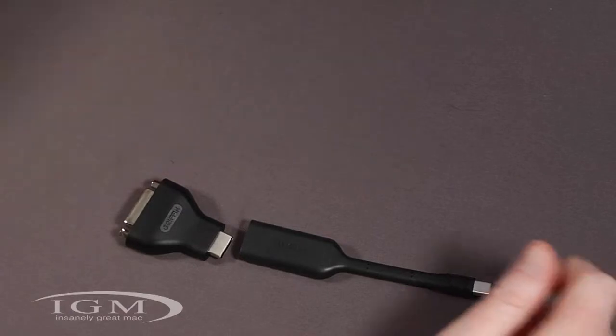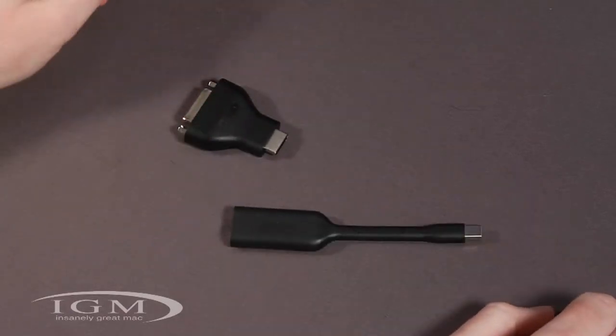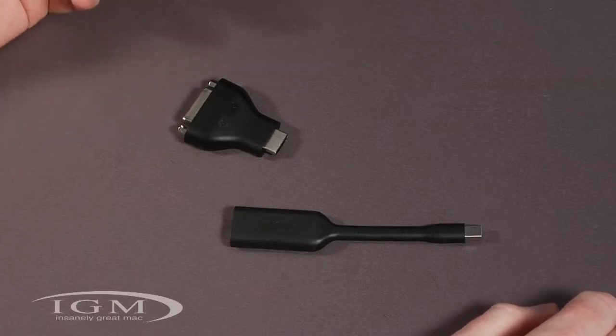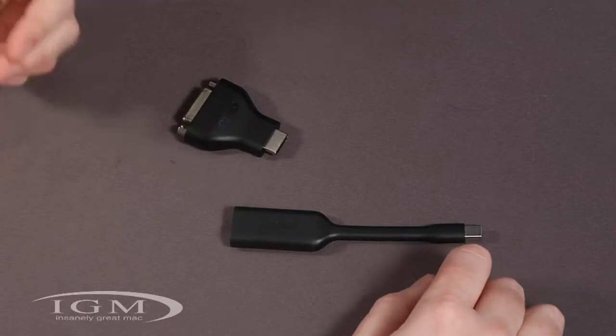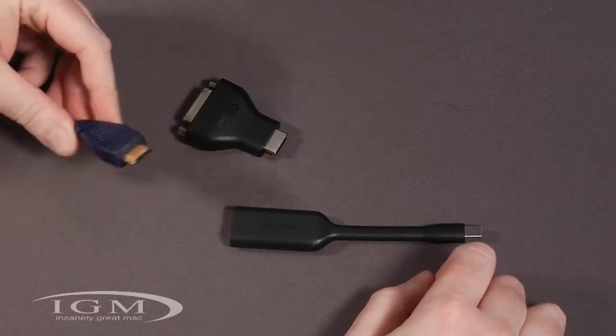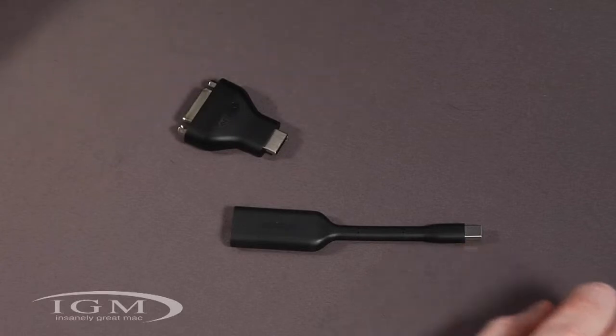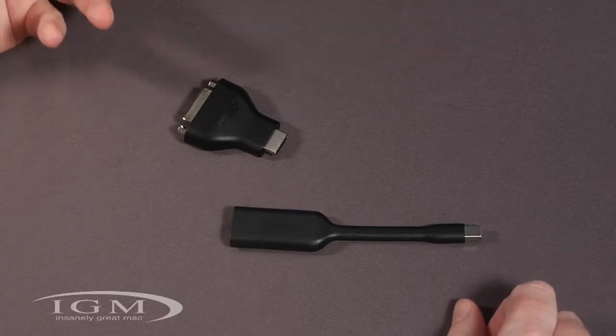All right. Now, on that line, I just want to mention that Apple's Mini DisplayPort does not support audio out. I guess the newer spec actually does, but Apple's ports do not. So if you want to get audio out, you're going to need to have a separate feed. And that's just a little bit different because HDMI usually has audio and video over the same cable. That's basically the big advantage of HDMI.